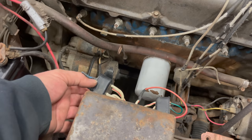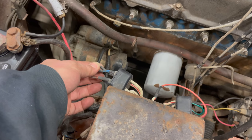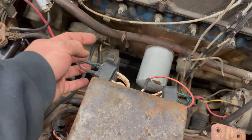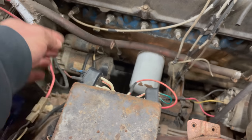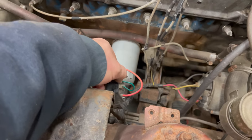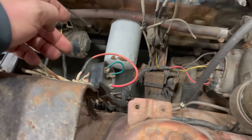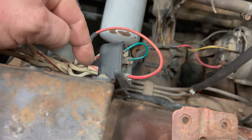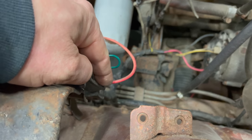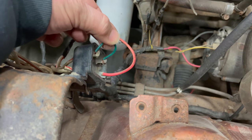The next place to look is the fusible links. You can see some examples right here — the different colors represent the resistance they're going to melt at. These cars have four of them, two in this box which should have a plastic cover on it. Someone's been in here and messed with this. This one here is all kinds of messed up — they cut a wire that usually went through a fusible link and just bypassed it straight to the other side without a fusible link. This other one just has a really junky wire right here.